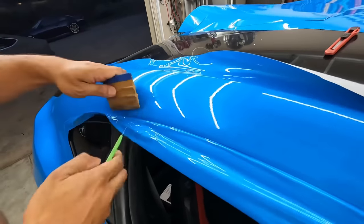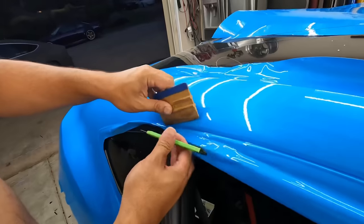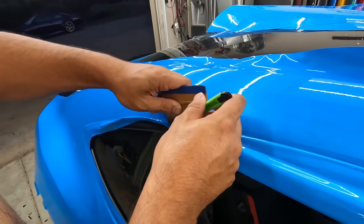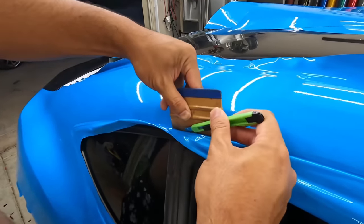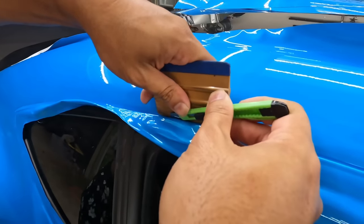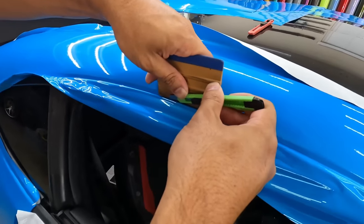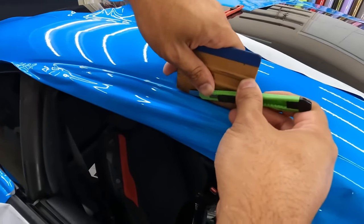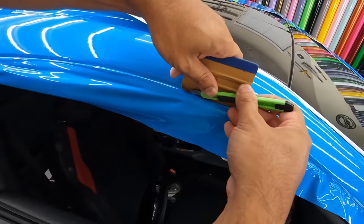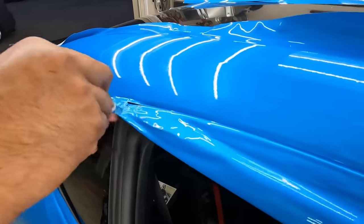Okay. How I do it is I tuck it in. I got a nice fresh blade that's very sharp. Because it's sharp, you're not putting a lot of pressure on it and you can still cut, thus you don't cut the seal. Rest the blade on that. You're just using the squeegee as a guide, okay? That's it, so you're not moving the blade, you're moving the squeegee. The squeegee just guides the blade because it's resting against it, okay? Just like that. And maybe you wanna get some of this off.